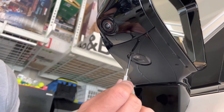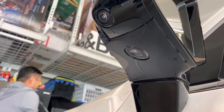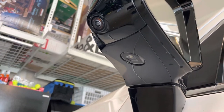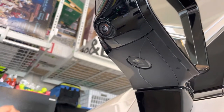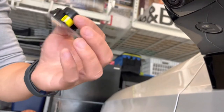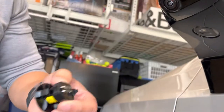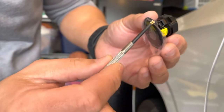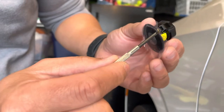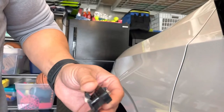At the very bottom of your side mirrors, you'll see this little notch which will allow you to pop it open. The brand new one comes with instructions telling you which is left and which is right — yellow is for the left driver side, white is for the right passenger side. Find the notch and get a small screwdriver that will fit right in.